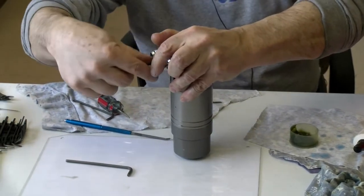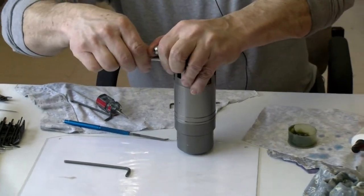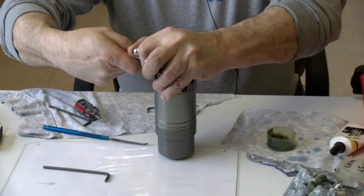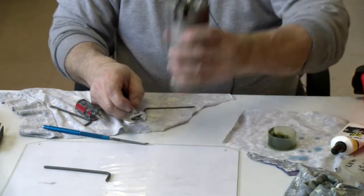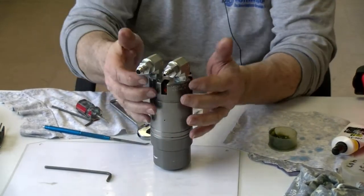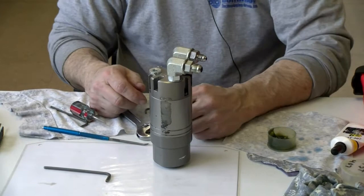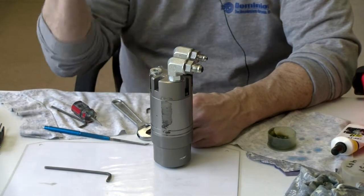And how long do you typically run them out for? I do 10 cycles, just like if we were running on the line, I simulate it. Okay. I fill up a tank, then I empty the tank, then I fill it up immediately again, then I empty it, then I fill it up immediately again. But each time I fill it up, I pull the adapter off and then put it back on like you're putting it on a car, for 10 cycles, and just watch for an accumulation of buildup to see if anything's leaking on the air lines, or if there are any leaks on the sides. Running them out 10 cycles usually tells you if you've got some. Most of the time, if it's leaking, it leaks right away.